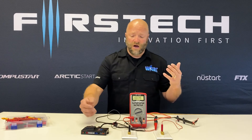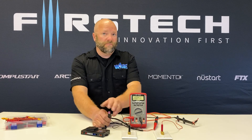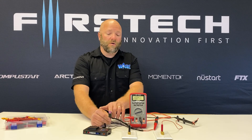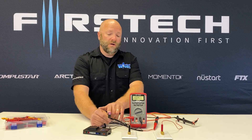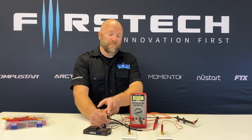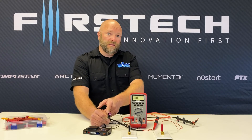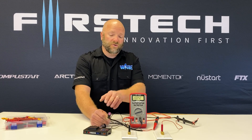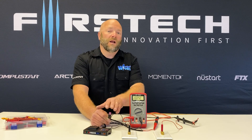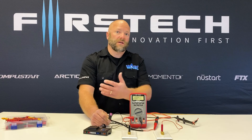One other thing: if this is in a vehicle install situation, you can remove the fuses from the fuse holder. For example, pull the fuses out, then put one probe on one side of the fuse holder and the other probe on the other side. The current coming from the vehicle enters one side of the fuse holder and current going to the brain exits the other side. This allows you to pass current through the meter very simply, making it a quick and easy way to meter current draw in the vehicle without disconnecting any wires.